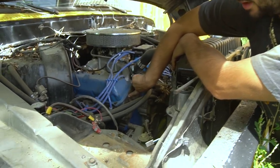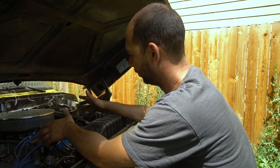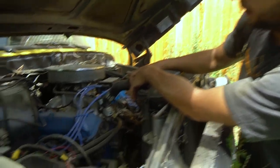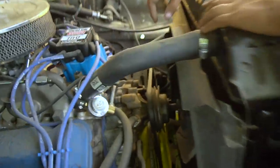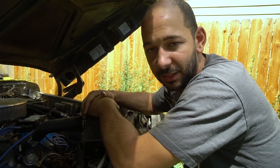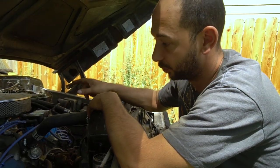It still has stock dove heads on it and a full adjustable valve train with adjustable rockers. I spent money having the heads rebuilt before I decided how crazy I was going to go. If I throw on a set of aluminum Edelbrock heads, the sky's the limit. It's got a Holley Dominator — I think it's an 1150 carb — and a GM style all-in-one distributor. The crazy part is it's 14-to-1 compression, so it won't run on regular gas outside of Colorado. Up here at altitude with so little oxygen it can run on pump gas, but I can't take it below a mile high. That's also where it makes most of its power, so if we ever wanted to supercharge it we'd need to lower that compression.